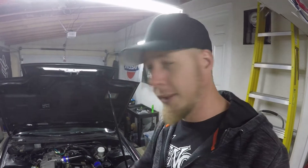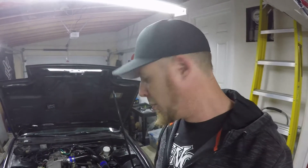One of the circuits — the green wire — is apparently supposed to go to the AC compressor so the module knows to turn the fans on. I'm going to use that circuit and run it up into the dash on a toggle switch so I can turn the fans on manually. I'll lay out all the wiring and figure out which directions I need to go, maybe start crimping up some connectors. It's pretty straightforward to install and I don't imagine most people who can work with wiring would have a lot of issues.